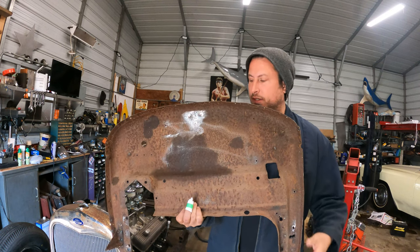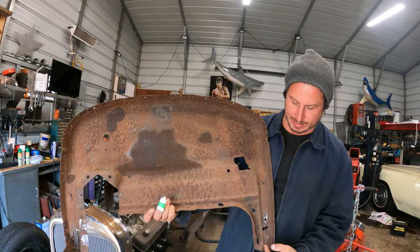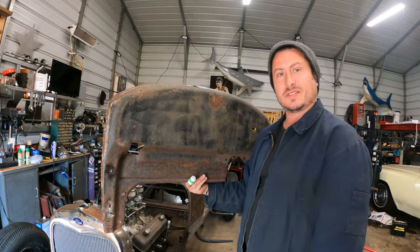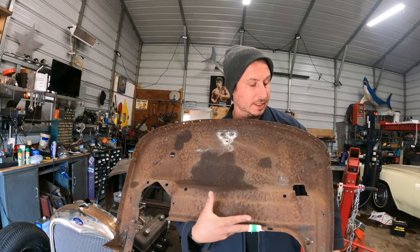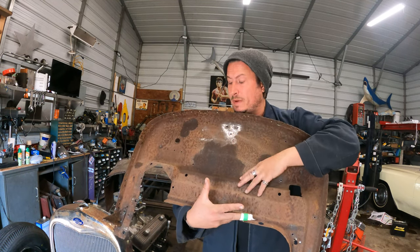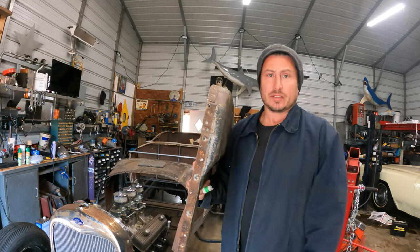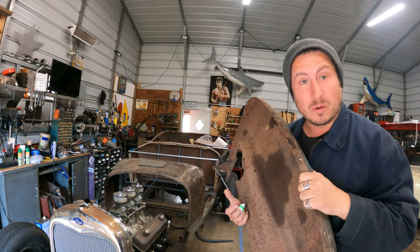When you're approaching this kind of situation, especially on a Model T, it's good to take a look at both sides. This is going to be our new engine-facing side — makes sense to cut kind of right here and then around the flat spot. But if you look from the other side, maybe you want to keep that sexy curve. So look at both sides and decide what you want to do. For our case, the most important reason I'm doing this right now is to get this structure back in the car. I'm going to cut all this out. We may or may not flip that back around so that this ducks in even further, because right now it's sticking out. Things won't line up perfectly — it's not as simple as just flipping it and welding it back in because we've got a lot of interesting curves here, but there's more to the story.